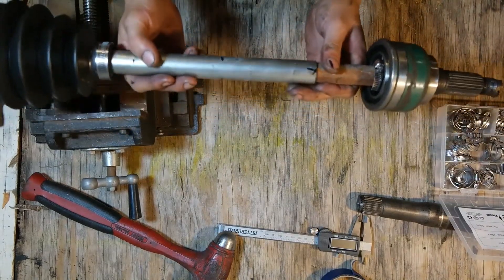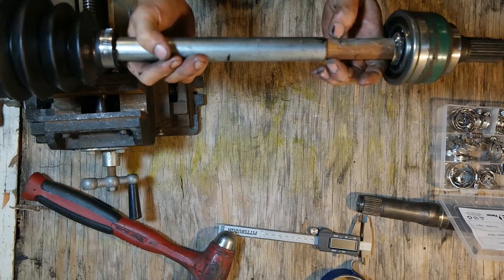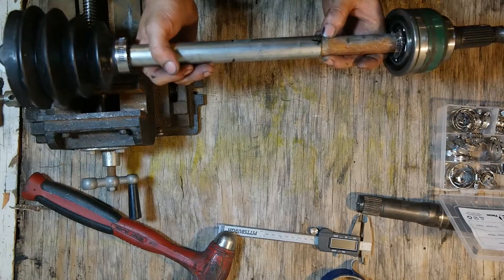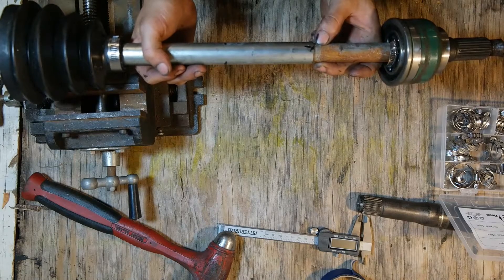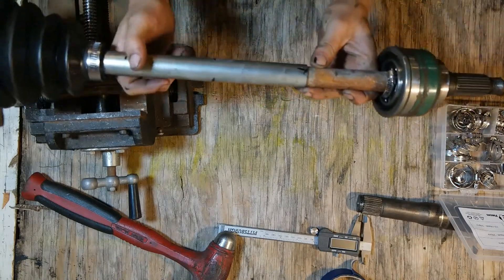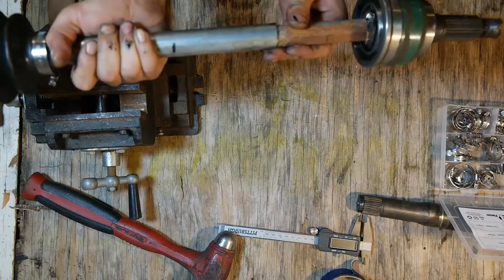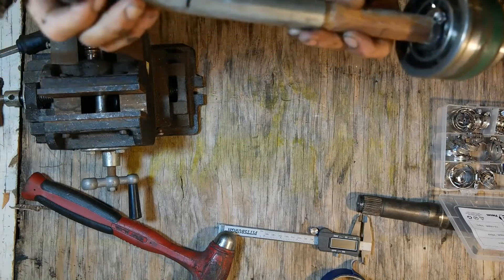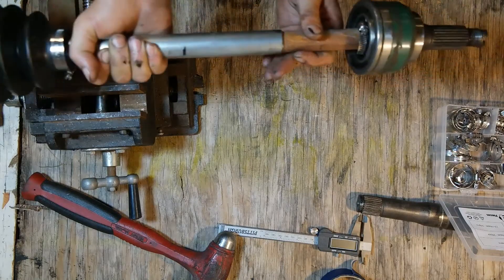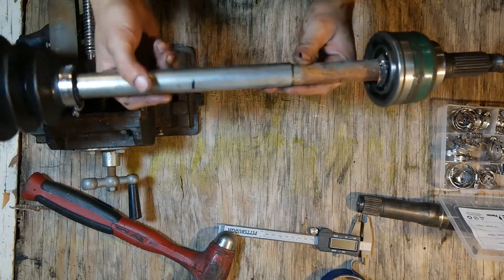And there we have it — now we can put this in the car. Since I already know the diameter that the outer shaft needs to be to clear the coilover, I'm probably just going to have to take the coilover out anyway, because I don't see any way to manipulate it on jack stands without the floor jack just lifting the whole car up. So I'll take the coilover out, get the tire about level in the wheel well, and run a self-tapper through here. Then we can manipulate the suspension and see exactly where this needs to be. We've got plenty of play to find our exact length — once we do that, we'll fix it in place and measure end to end.